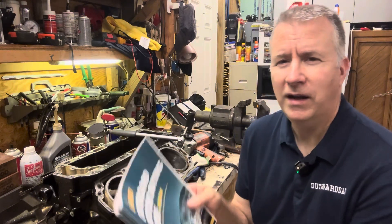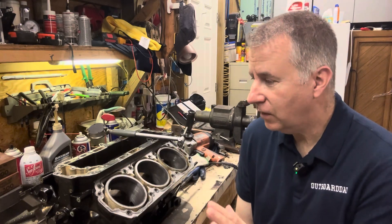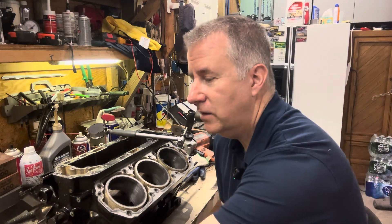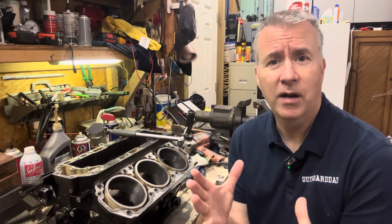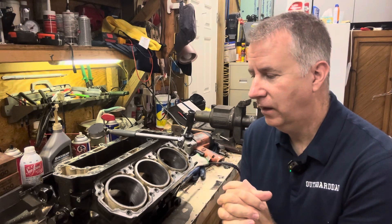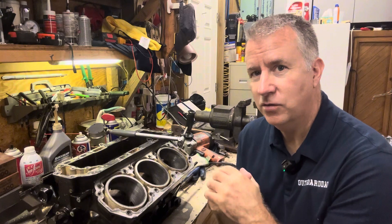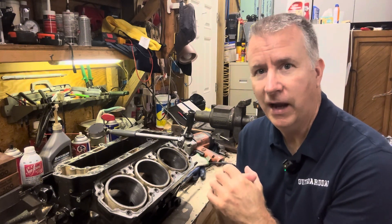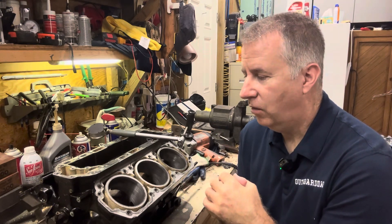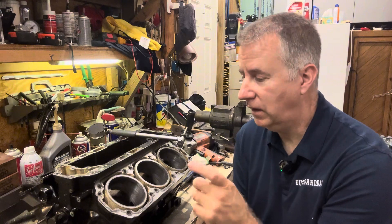My goal was to cover a broad range to help as many people as I can. Looking at this motor - what did we discover in our last video? I started to do some honing, and some of you may have noticed I got a comment: aren't you supposed to put oil in there when you're honing? When honing with these stones to bore larger, I do it dry - you'll get a lot of filings and grit inside there and it takes away material.